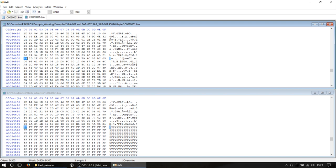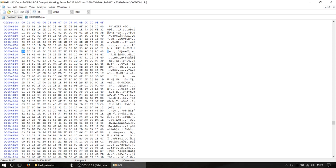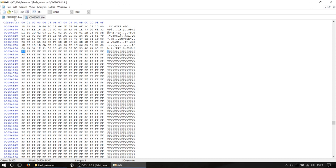In issues like this one, and the one we've pulled off our PlayStation here, you can see has a massive bank of Fs. So the blue text is where it highlights the first difference. Okay, you can see in the working version it just looks like gobbledygook. Again, from the same point where it's identified the first difference, if we look in our file, look, it's just a big bank of Fs. If you go further down, you'll see it's absolutely just swarming with Fs.